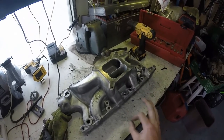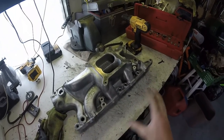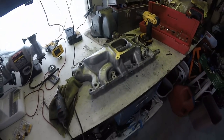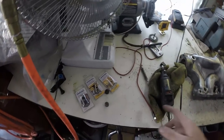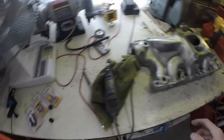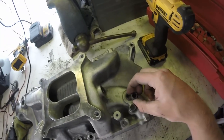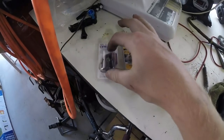It should be fine for what I'm using it for, but you really don't need to port stuff like that. If you are porting something, make sure to draw lines and trace them. When you're cutting, be careful — once you go too far, you can't go back. It's cast aluminum. I ran out of wire wheels because they kept demolishing themselves, so I got some more, along with some plugs and finishing pads.